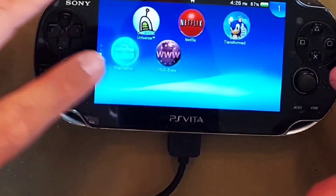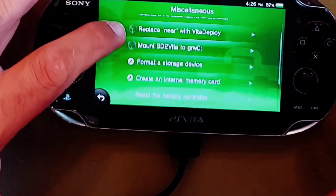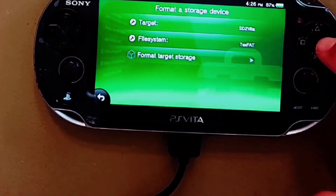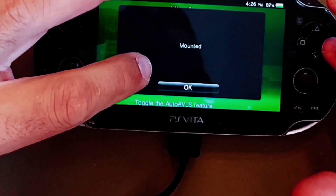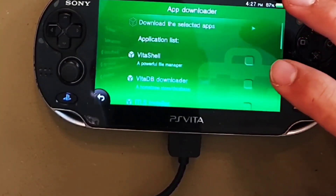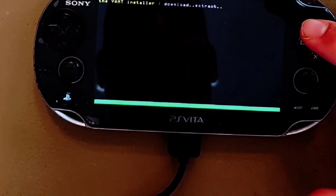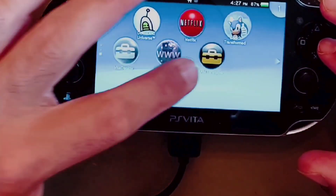With the SD to Vita Pro adapter and SD card inserted, scroll down to Miscellaneous and then tap 'Format Storage Device.' Make sure the target says 'SD to Vita' and the file system says 'exFAT.' Tap 'Format Target Storage.' After it says formatted click OK and back out. From here tap on 'Mount SD Vita to GRW0.' Once that's mounted we'll get a few more applications. Back out, go into App Downloader, scroll down and select the YAMT installer. Select the application to install, scroll back up and hit 'Download Selected Apps.'